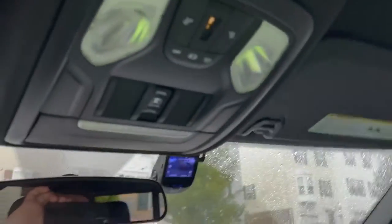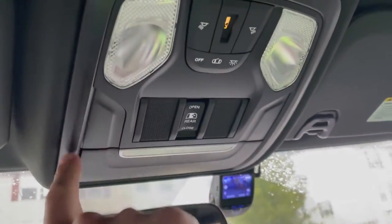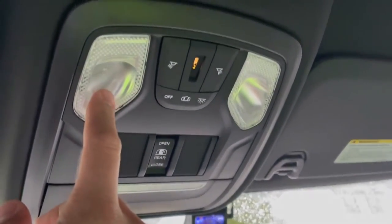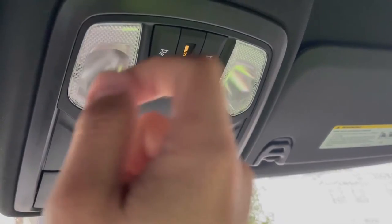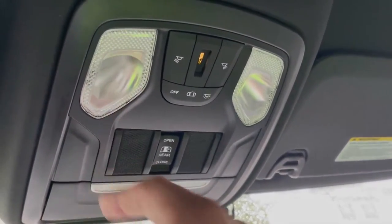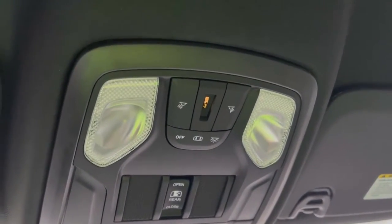If you're watching videos online, do not pry around this to get it down — absolutely do not. The way we're going to approach this is to take these two lenses out and take the bulb out and put the new one in. However, there's a reflector in here that's chrome plated; once you get fingerprints on it you can't get them off, and it chips very easily. So I'm going to put my gloves on and start the process.